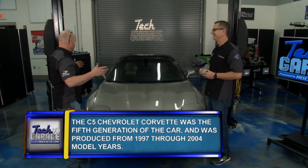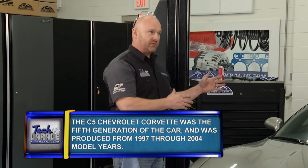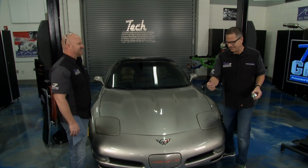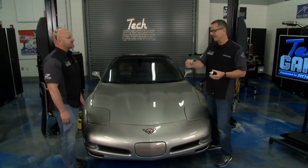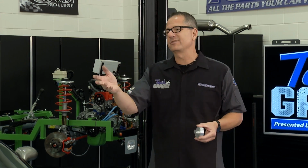You know, I tell you what, finally you rode in here in style in something for a change. I think I have an idea of a starting point on this C5. It's one of my favorites. There's some common failures, but talk through your symptoms again. You had no grinding, no lockup prior to that? No burnout, but no grinding, no lockup, no anything. I went to shift it, and a couple of symptoms is it's actually falling back and forth real easily. When I went underneath to shift it, very easy to shift as well. I mean, it's probably a cable issue, but there's always a visual inspection in order.